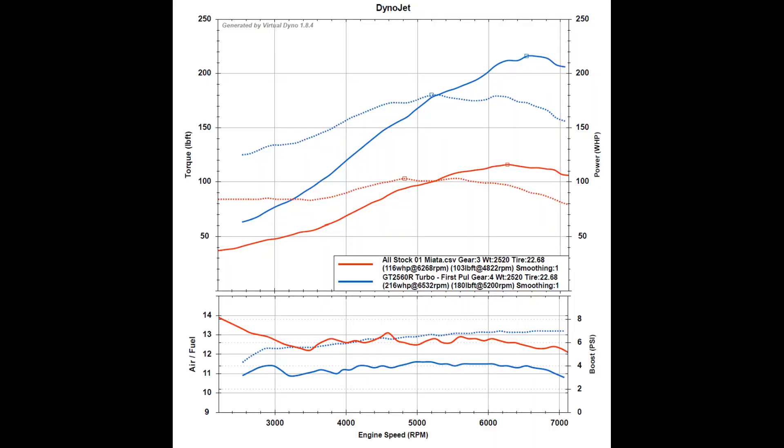Here's the virtual dyno pull after I got it up and running. It's an 86 percent increase in horsepower and a 75 percent increase in torque. This is not tuned — I didn't tune the ignition, I just tuned the AFRs. I'll be posting a video of how to do your first start for a turbo build in a future video. It will be an advanced MegaSquirt video. I made an introductory MegaSquirt video for MS2s already and that's posted on my channel.